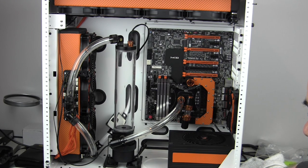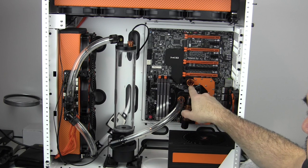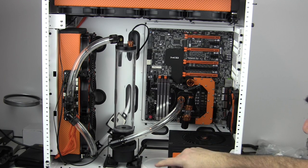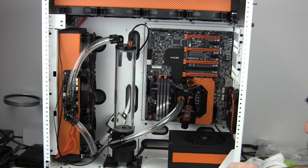I'm taking Callum's suggestion and flipping the Raystorm block around so the inlet is on this side, while leaving the trim on the outside so you can still read XSPC. It's got a nice smooth loop, no crossing tubing, and a short run going right to the chipset block. I think that looks pretty good. So this is the final loop order — well, I say that now, we're not done yet. Next up, we've got to get water blocks on the GTX 680s so we can stick them in and get fittings and tubing done.